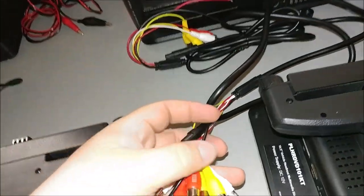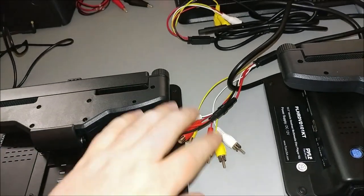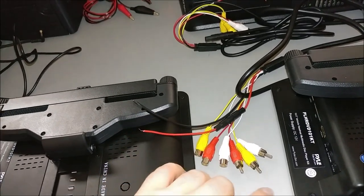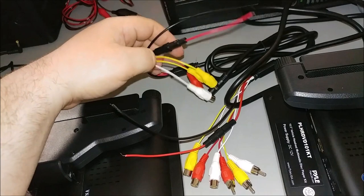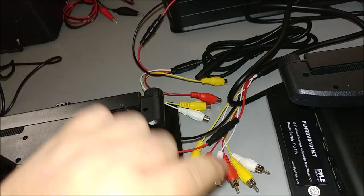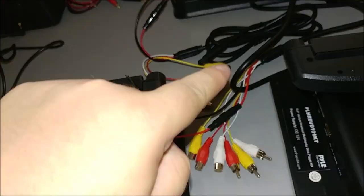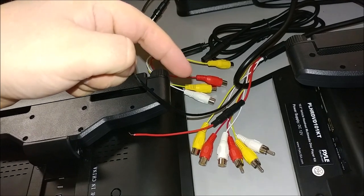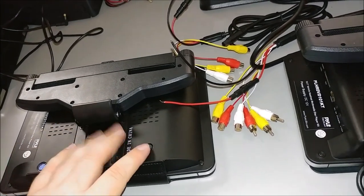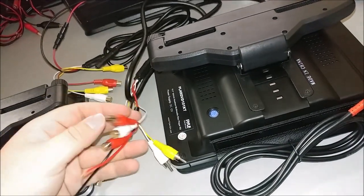The linear wiring harness over here with the AV cables — you'll see one is the master and one is the slave. You know which is the master because there are no outputs on the slave. There are no male connectors, just the female connectors. The female connector one is your slave, going to the unit that does not have the DVD player.